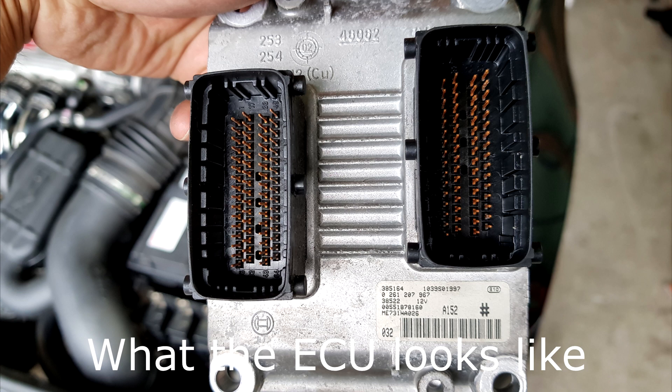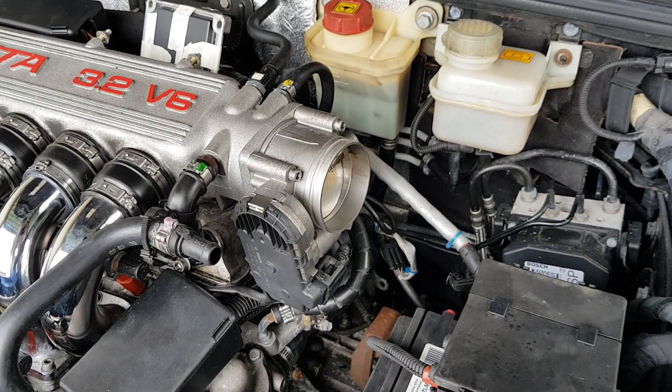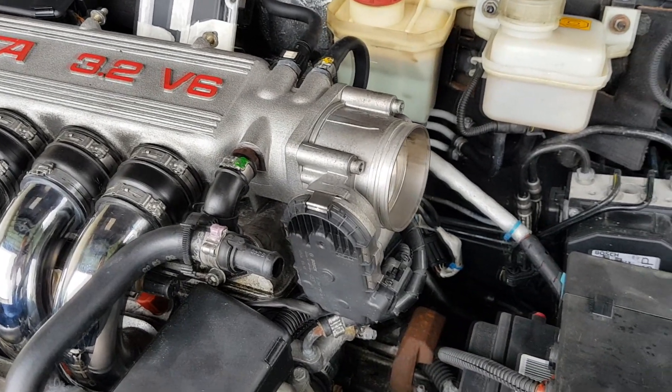I think it's the combination of heat and vibration that really causes issues on the ECU. This started a bit of a witch hunt, and everyone online was saying that if you're able to unplug the throttle and the engine idles with the throttle unplugged, then it's definitely an ECU problem.